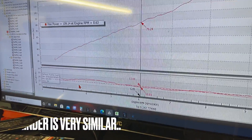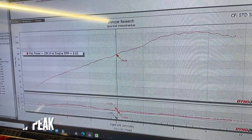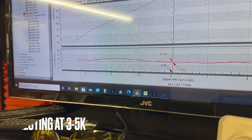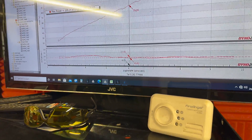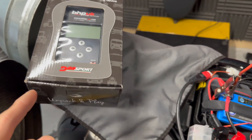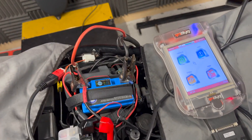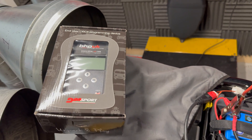You can see the two red lines pretty much overlay each other. There's a thinking that every V-twin runs different air-fuel ratios front and back cylinder — some do — but we've just shown an absolutely negligible difference, and honestly that variation could be down to the sensor readings. What's available now for the Hypermotard — for you Hyper boys — is this handheld mobile device. You can buy it from the website, plug it into the Euro 5, download all the software. There are instructions; you don't need to remove your ECU anymore, you can do everything with this device and send the file off to them.